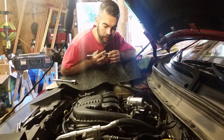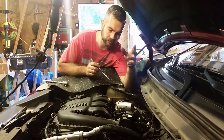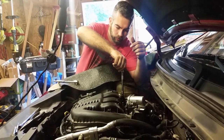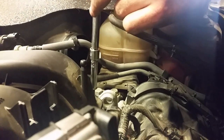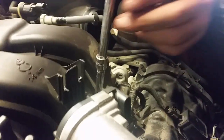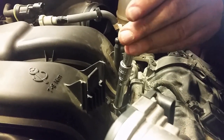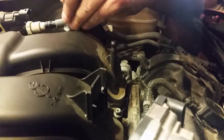Anytime you're working with steel bolts or metal bolts going into plastic, this is something I highly recommend. I think I've said this before on the channel, but in case you haven't watched that video, what I like to do is reverse them. You'll feel it pop. Go ahead and get a close up here, because this is a nice signal. You'll hear it pop. What that pop is, is the threads lining up, so you know you're not making new threads. Because it's very easy for this metal bolt to make new threads in that plastic below it, and it makes it strip out. So what you do is you run it backwards. Hear it pop. And then you go forward a little bit, and you can feel it catch that thread.